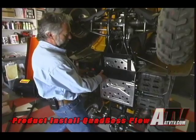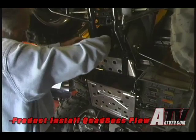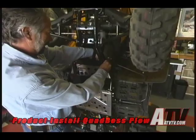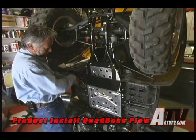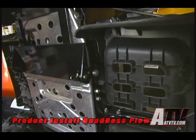Once you get these replacement bolts in, leave them loose as you get ready to put the U-bolts in. I can't believe how much easier this is having the ATV set up on end like this. Do both U-bolts while you're at it, and that's the advantage of leaving things loose — if you tighten something down early, you're going to have trouble making things line up. Remember, this is the part that stays on the ATV even when you disconnect the plow, even when you go trail riding or riding to the post office. Now we're all tightened up, ready to drop this down.